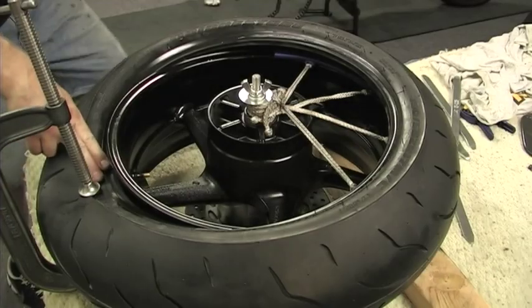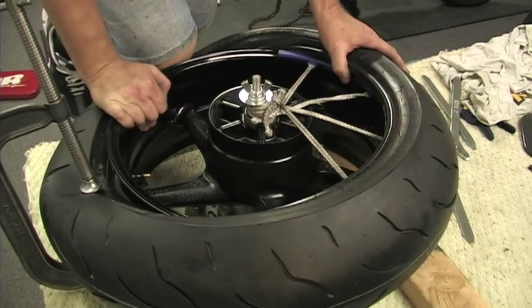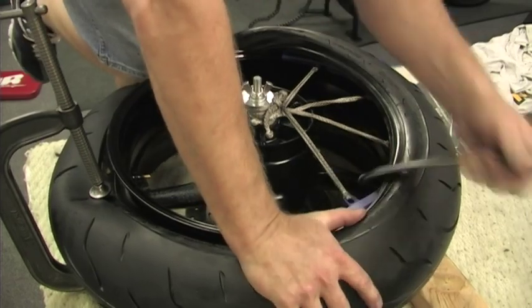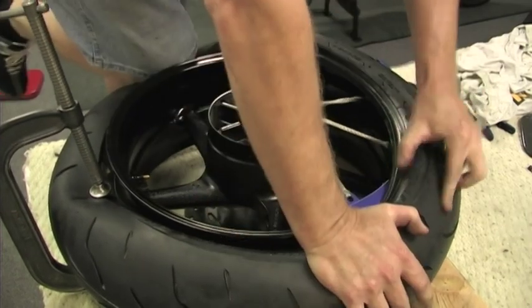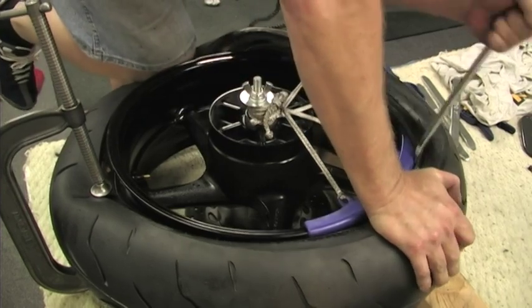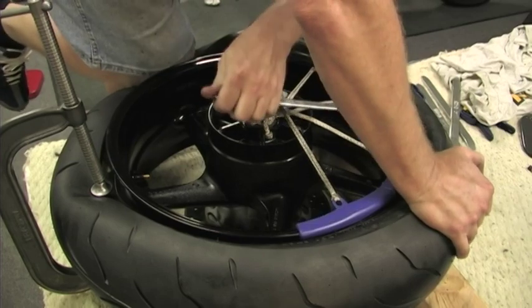Pledge, locate valve stem position, orient the tire, clamp it at the back, 4 rim protectors tied into a group at the top, knee and right hand at the 8 and 4 o'clock positions. Alright, working from the right side, I am moving the irons just an inch or so each time as I progress counterclockwise, and each time using my right hand to secure that progress.